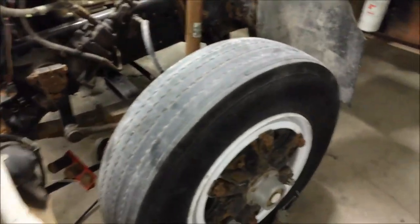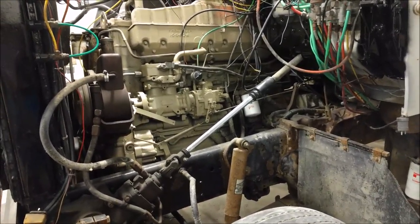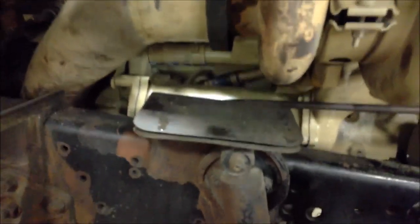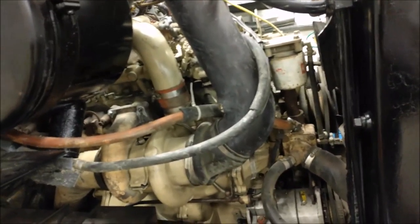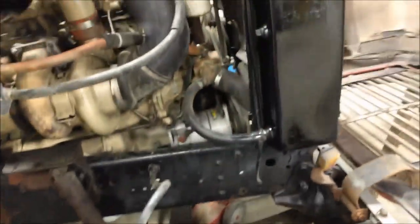So I think that'll be it for this video. If you guys want to see more of this, let me know. I can take you through more of the in-depth parts of what I did — how I rebuilt the pump, resealed the oil cooler, I had a little bit of coolant in there. Pressure tested the cooler and resealed it. Painted everything up real nice — this whole place side was black. Painted the turbo, added a new flange to the back of the exhaust, it was busted. I'm in the process of painting some stuff up. I'm waiting for a new fan clutch — it is shot and they are very hard to find for these old trucks. So it's a little bit of a fun game, but I'm getting there.